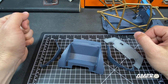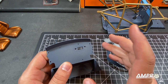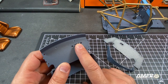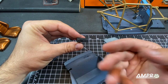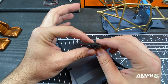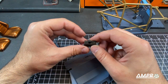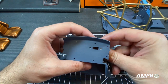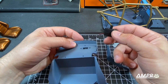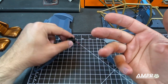Why? Well, because I made it overly complicated. So on the rear deck, this is where the on and off switch is going to be. I know you're thinking that's going to be super unsightly — don't worry, I got you covered. In the meantime, we have to mount a switch. This is a standard Tamiya on and off switch from one of their ESCs. It's a pretty generic size switch with the mounting points being 19 millimeters apart. So as long as those are 19 millimeters apart, the actual opening should be pretty much in there. The problem is this must be mounted ahead of time and we don't have the ESC in yet, so we're going to go ahead and extend these wires and put a removable plug on it.